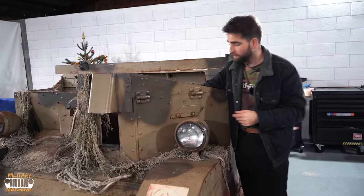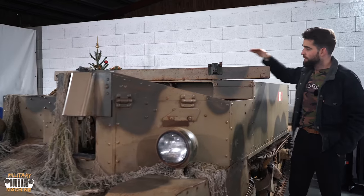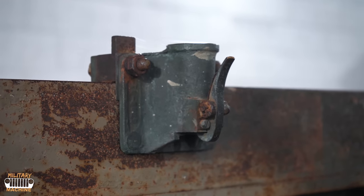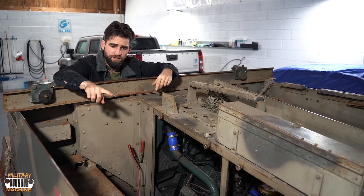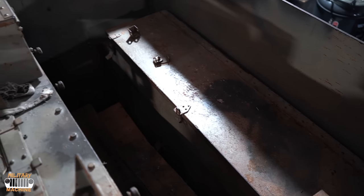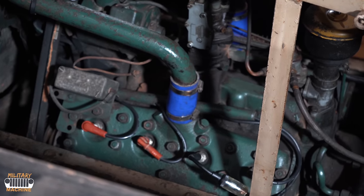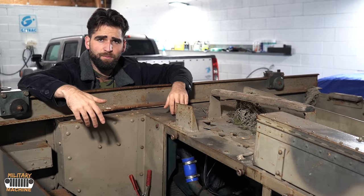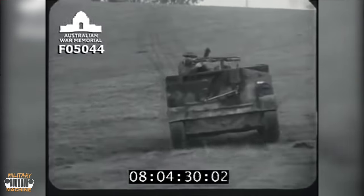There are small vision ports to see if you were being shot at — though since it's open-topped, I doubt they offered real protection. There's a semi-peripheral rail, not very long, that allowed mounting machine guns or rifles on the upper section. The rear compartment held an equipped soldier and many crates for ammunition storage. The central engine is a commercial Ford V8 from the 1930s, used in American sedans and later turned into hot rods in the '50s. This one has 85 horsepower and could tow the armored vehicle to a maximum of 51 km/h — not bad for a 4-tonne vehicle in the 1940s.